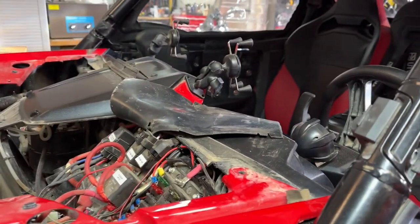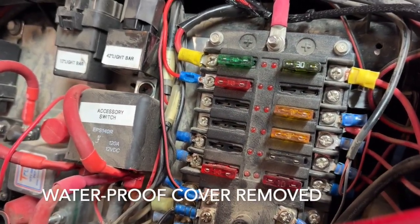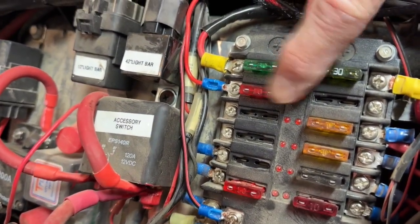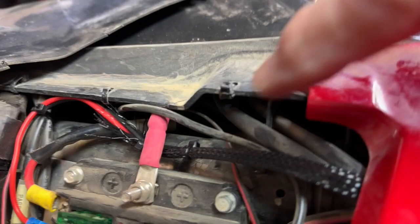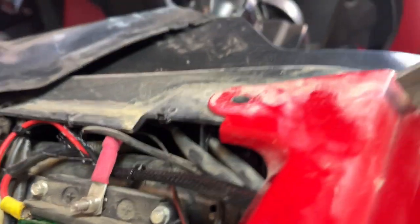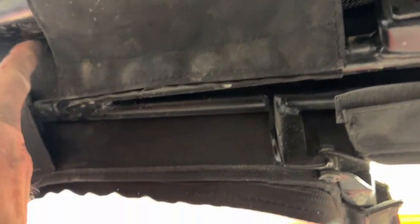For the light whips, I am using a fuse panel that I installed quite a while ago. This is where I've connected the light whip — you can see there's a 10-amp fuse there, and ground is right there. I ran 18-gauge wire through a protected cable cover up the pillar and tucked it up underneath this area so it's not visible and it's also protected from the weather.